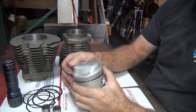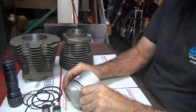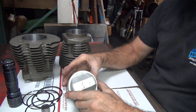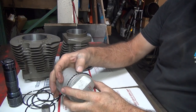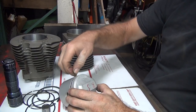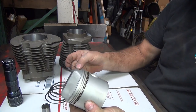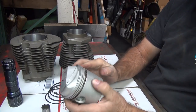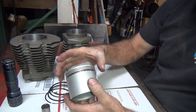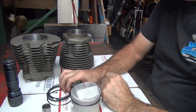If there's a marking, it goes up. This one has zero marking. Sometimes you have to highlight it with spit or a scrub pad because it might be really faint. These top rings don't care how they go on - they're steel, you can twist them all day. These are cast iron - if you twist them, they stay bent and they're screwed, because when you twist a ring, it's no longer flat and will never seal. If it doesn't seal, it never breaks in. So this has a gap on it. You don't want the gap on the thrust face or on the direct piston side - you work on the 45s and stagger it.